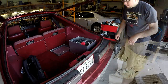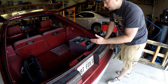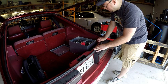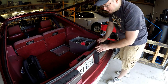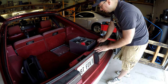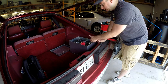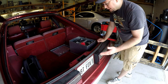Let's go ahead and get into the car and make a plan of action. As you can see, I do have my battery located in the trunk. If I ever plan on taking this car to the track, it's a good idea to have a rear battery disconnect — a lot of tracks actually require this when you're running the battery in the trunk. I'm going to go ahead and disconnect the battery and remove these two trim panels so I can lay out the cable. I plan on mounting the disconnect about right here, so we've got to mock that up, make sure it's in the correct orientation, and then start measuring out the appropriate cable length.